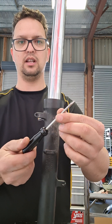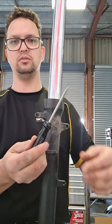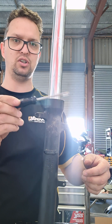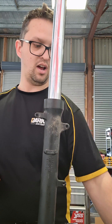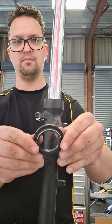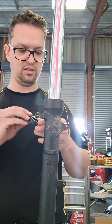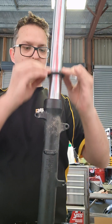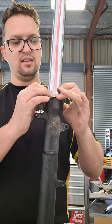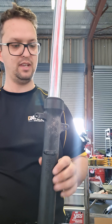There's a special fork clip tool you can get — most professional tuners will use tools like this, not a flat screwdriver. As you can see, we've got some decent seal grease — this is Ohlins seal grease, we only use Ohlins, it's really really good stuff. Now we put our dust cover in — a nice new dust cover from SKF.